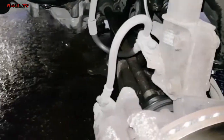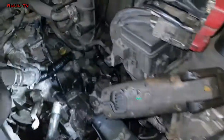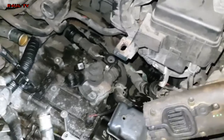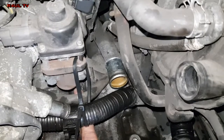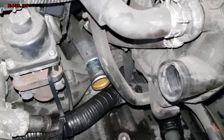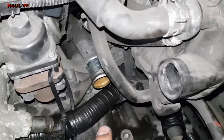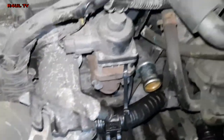We've got it on, struggled a little bit but we've got it on. Now finishing off: reverse order — get the drive shafts on, ball joints on, and get the oil in. Drive shafts are on, bellhousing bolts are on the bottom, everything is done underneath except for putting the oil in. I've come to the top — put the top bellhousing bolt on, starter bolt is on. The bottom starter bolt is hand tight so don't tighten that up just yet. Send it up and tighten that bottom bellhousing bolt.